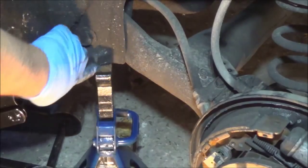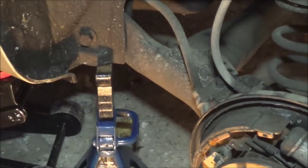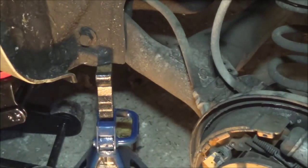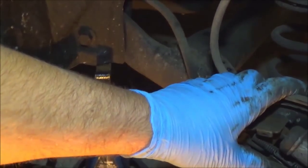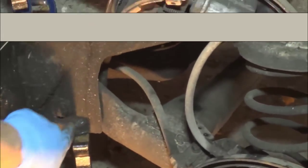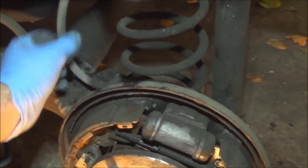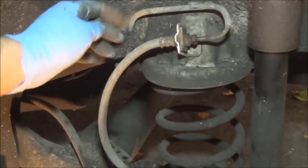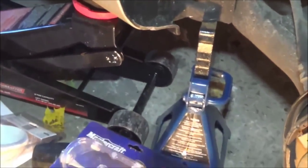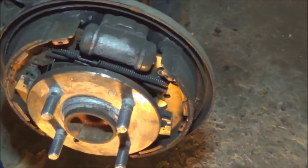Since we got the tire off, see that right there? That's the piece I was talking about — that's double reinforced on each side. Not on the control arm, because this bar goes this way. Do not jack up there either — you can damage or dent it. The only thing connecting the suspension is the spring, the shock comes down, sits underneath the plate at the bottom, connects to the control arm. That's all the rear suspension there. Here's your wheel cylinder, brake hose runs in there, and that's where you place your jack stand.